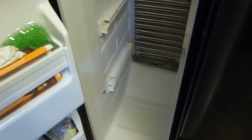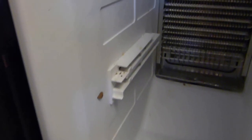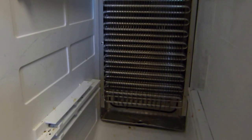We've been dealing with this for about two years — I finally just decided I'm going to see if I can get this fixed. Like I said, take these panels off; it's just a couple screws to get them out. Definitely pull the plug. One thing I tried while this was still installed is I tried to just pour water into the tray here and it just dumped all down here because it was not draining down this pipe like it's supposed to. If it is draining through this pipe correctly, that may mean you have a different issue — something's not working right and it's defrosting too quickly. I hope this video helps you guys, thanks for watching, good luck.